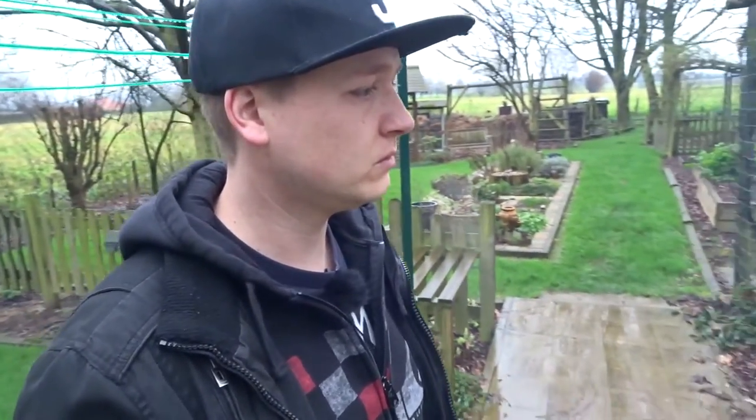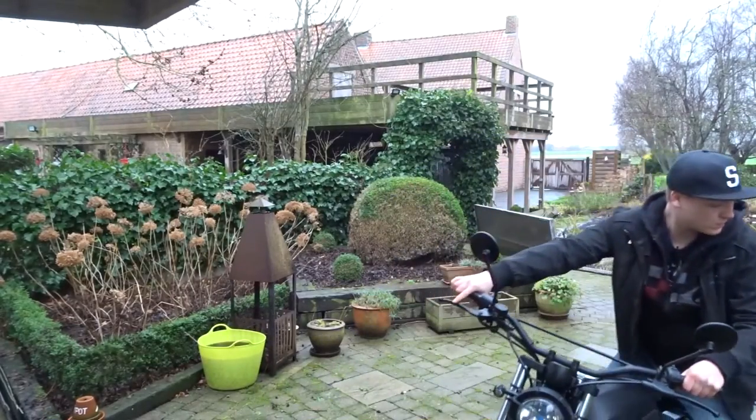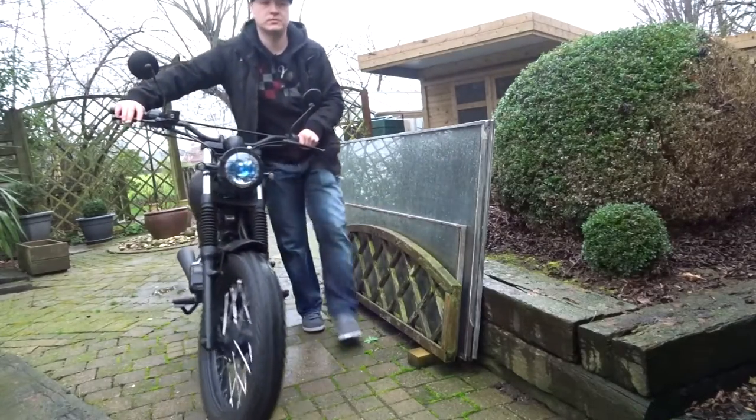Let me get out of the noise. So there's a lot of smoke because the old fuel was 25 to 1, now it's at 40 to 1. That's a hell of a lot of smoke. Runs good. So what I'm gonna do, I'm gonna leave it for like 15 minutes, 20 maybe, while I work on the Brixton. So the RCX is running to clean out the oil and the exhaust system.